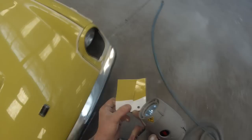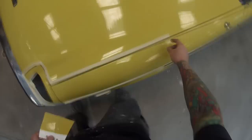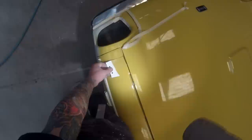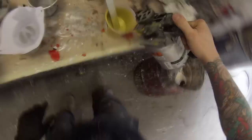I'll give you a quick look at the colour and take you through how I do the colour matching. The one on the right was just a bit too vibrant — a bit too yellow — so to kill that down I used a bit of black and white, and that's the one on the left there. It started to tone it down and get rid of that vibrant yellow, but it was still a little bright, so I added just a touch more white and black to grey it out, plus a bit of lemon yellow.